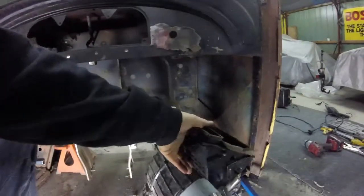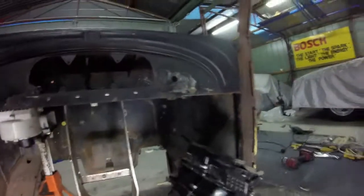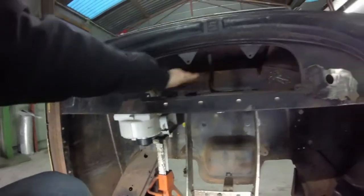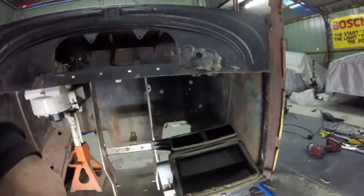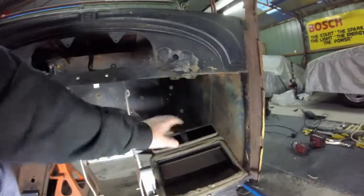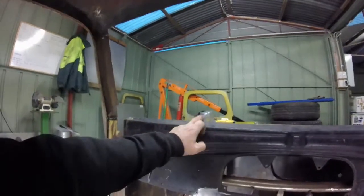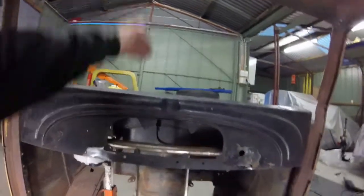I've determined that this is a completely flat fit across all three units. What protrudes this side up against the bar here, and how far this is going to sit over — that's going to be the issue if there is any issue. These two vents here I'll use; I've got all the original ducting out of the Festiva so I've got the part that slots straight onto there. I'll use this for my windscreen demisters — I'm going to cut a couple of slots in there and the ducting will run straight up to those slots. That'll be the windscreen taken care of.